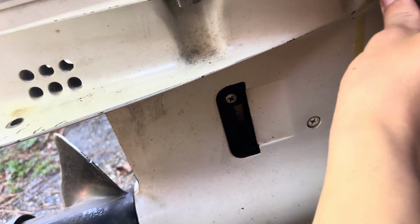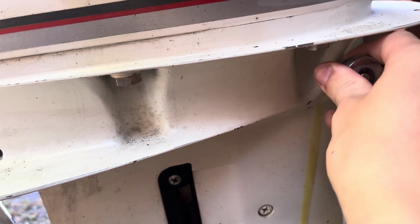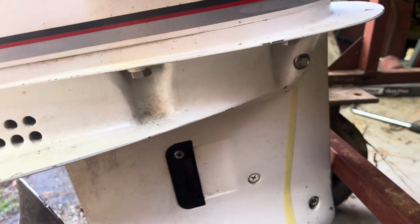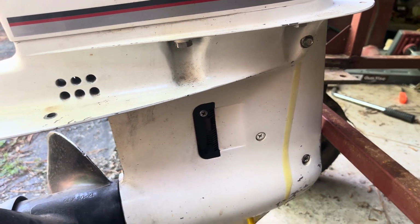Oh, it was a 10mm plug. Funny. But yeah, just tighten it up in there. Just be careful not to over tighten it, just snug is fine. You will rip them threads out of there because they're not very good threads.